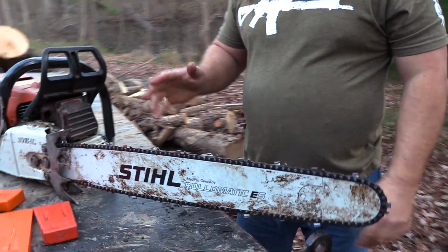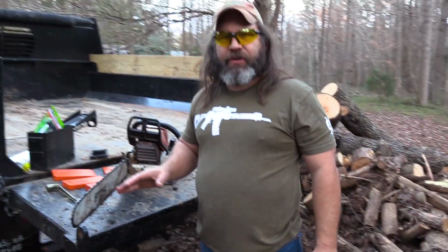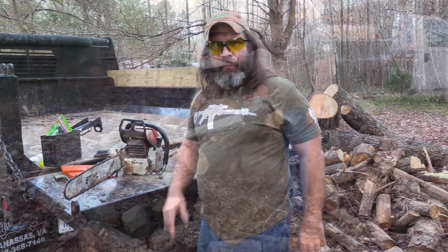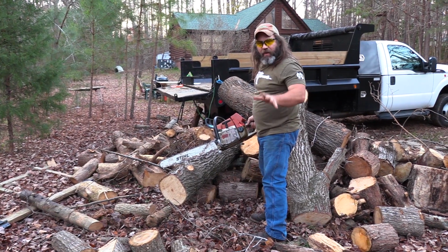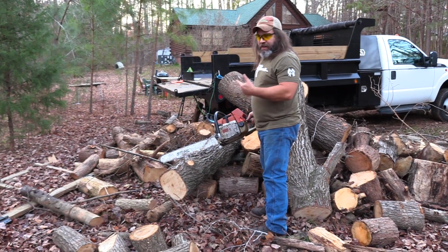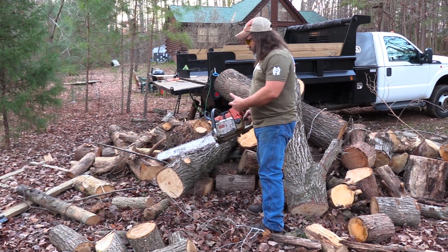And I'm going to do a little demo real quick. I'm going to get this. Obviously, I haven't sharpened it, so by the magic of video editing, I'm going to just run this real quick, and then I'm going to show you what it looks like with a good sharp chain. All right, y'all. So I got both sides sharp. I hit the rakers just a little bit. This is hickory, and it's only been down a few weeks, so this is hard as a brick bat. Let's see how she does.